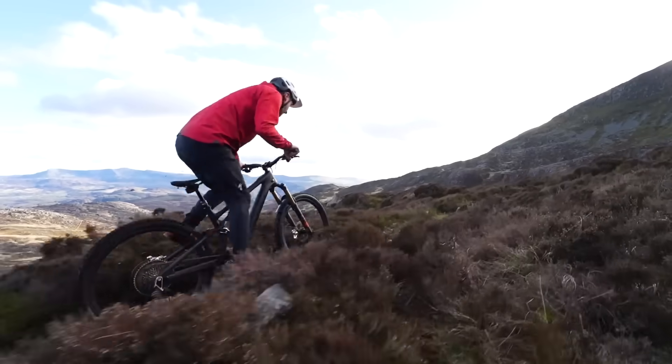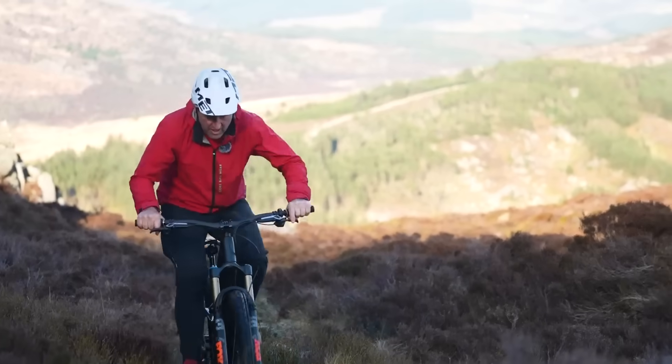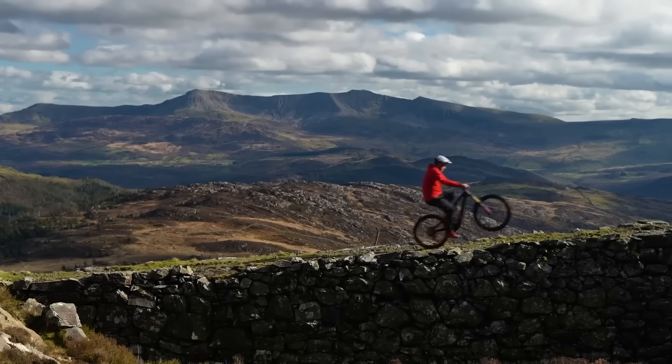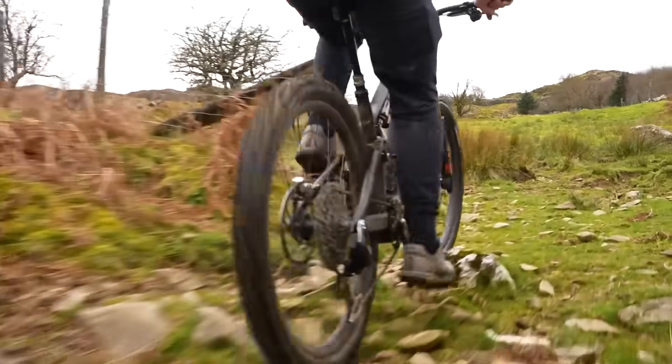However, if you're going to change it anyway, why not try it out with the existing 32 tooth? You're going to get a new feel with this bigger wheel — you're going to be rolling over stuff, carrying more momentum. You might actually want a bigger gear to take advantage of that momentum, rather than with the 27.5. I certainly feel like I'm accelerating a lot more with a 27.5, so I do like a lower gear with that anyway. So long answer short: try it out, and if you don't like it, you can always drop to a 30 afterwards.